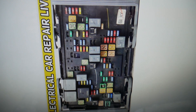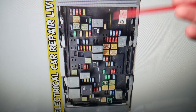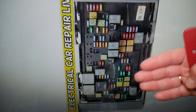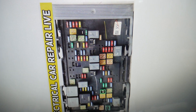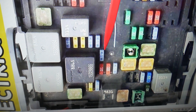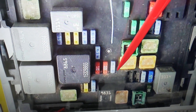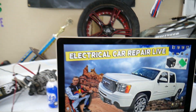For the DRL lights — daytime running lights — we need to check not one but two fuses, depending on which model and year of GMC Sierra you have. If you need to buy any fuses, relays, parts, or tools for the GMC Sierra or any car at a really good price with quick shipping, we'll put the link in the description of the video below — check it out, you can save a ton of money. Here we're going to work in that section towards the front. If we zoom in, the first fuse we need to check is fuse number 31, right here. The second fuse you need to check for the DRL lights is fuse number 33. So fuse 31 and fuse 33, right here. If you have any questions, let us know. Thank you guys for watching and see you next time.